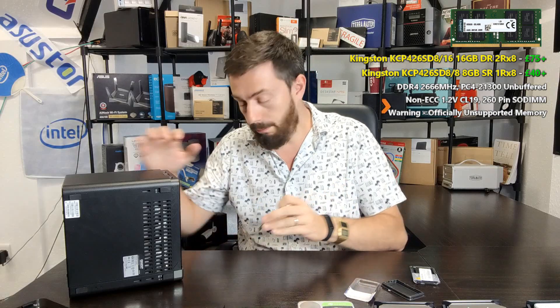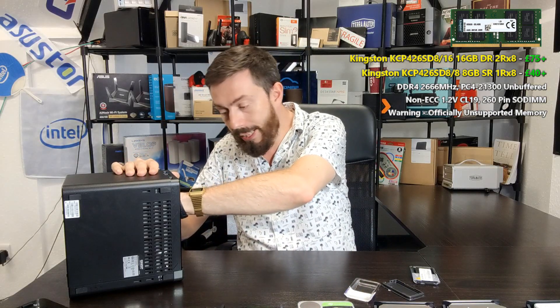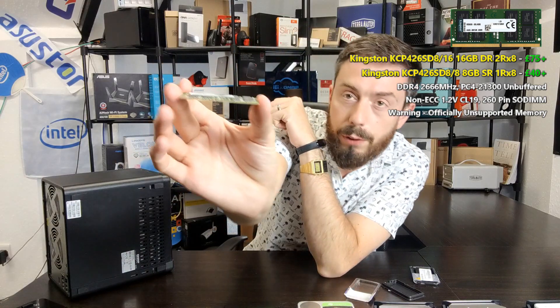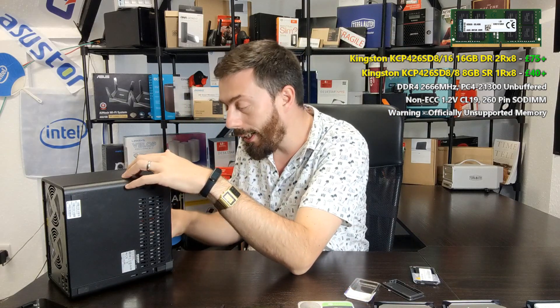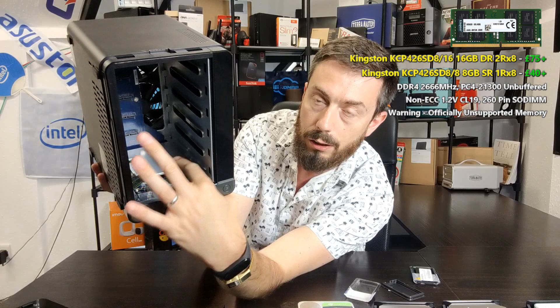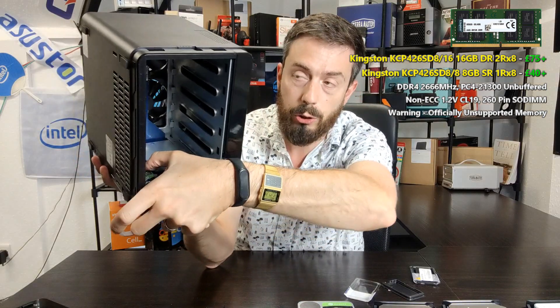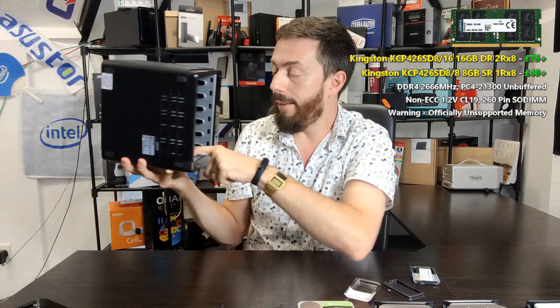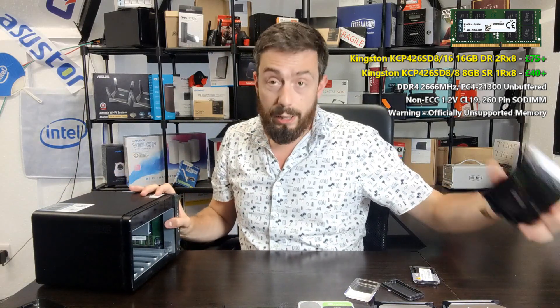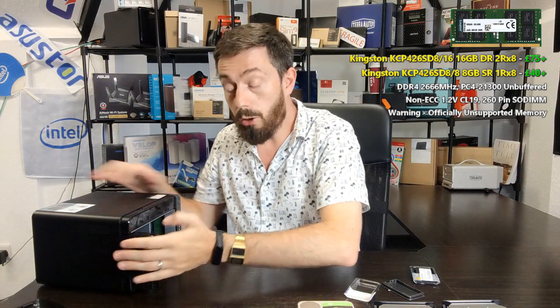So just make sure you're using dual rank for 16GB — that means 8 chips on one side and 8 on the other, giving you 16 times 1GB. Also make sure it's DDR4 non-ECC 2666MHz, and make sure it is SO-DIMM. They're quite easy to install because the alignment of the module has one longer side at the base, so it's clear which way it goes in. It uses a lever mechanism — pop it in, it will be raised up, then press your finger along the edge of the module, push it down, and you'll hear a double click as both arms on either side lock the module in place.